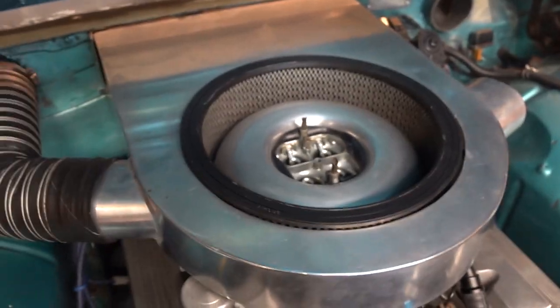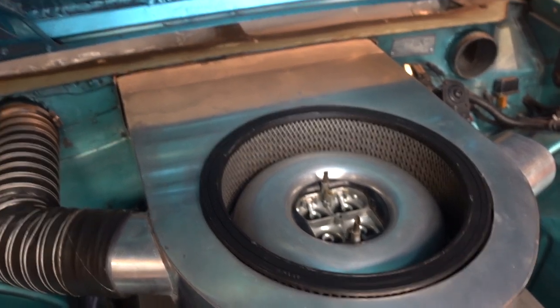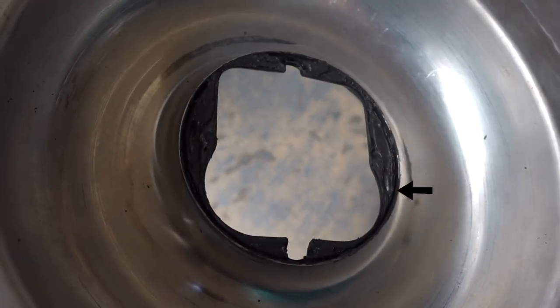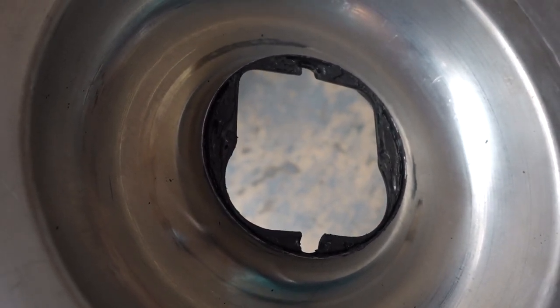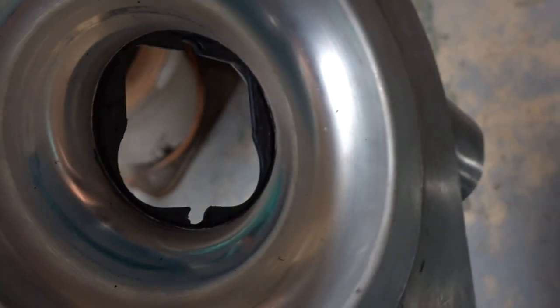Then it's just a four-inch filter, so there's plenty of room, plenty of air — it all comes through the cowl. I'll show you the bottom of that. You can see the way that's cut out. There's actually a little ring along the edge that just seats the carburetor flange onto this. Eventually I'll make this piece out of aluminum, but for right now I'm just kind of working on this.